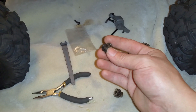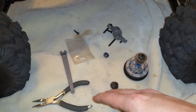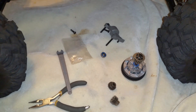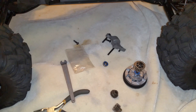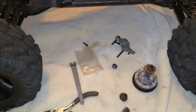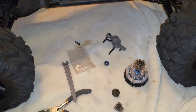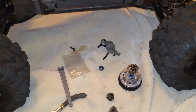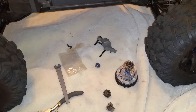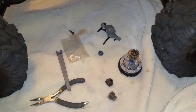My T-Maxx came with a three-channel TQI transmitter, so I already have the TQI set up. I want to get the telemetry expander. To summarize: go with a bigger pinion, you get higher top speed; go with a smaller spur, again higher top speed. Go with a bigger spur and a smaller pinion — lower top speed, more torque — but it'll get up to that top speed a hell of a lot faster. That's when you're looking at acceleration and not top speed.